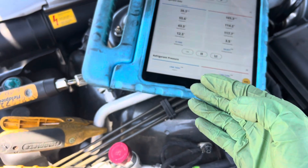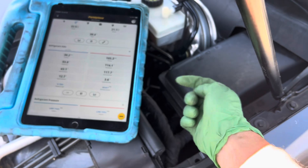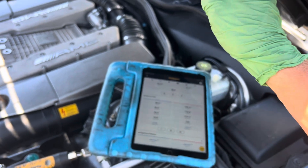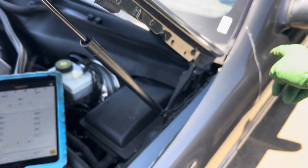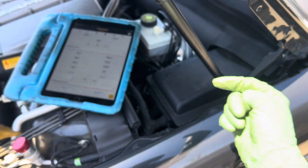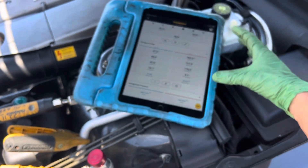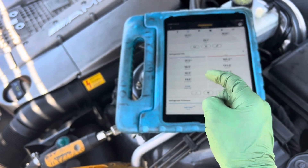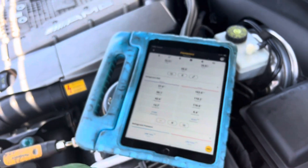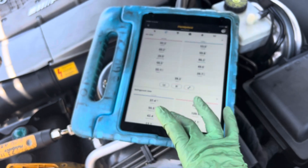Same with my superheat — I can't get back there towards the evaporator. We also have the second T coming in from the rear evaporator subcooler, so I'm getting an overall subcooling reading from both front and rear, with several feet of uninsulated line from the rear evaporating teeing in. So my superheat is wrong and my subcooling is wrong, but it gives you a general idea. Let's throw some RPMs on this thing.